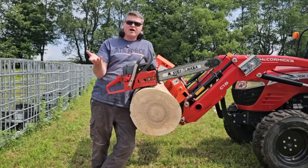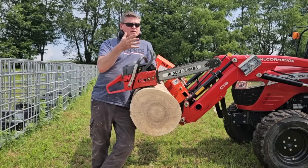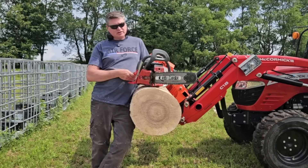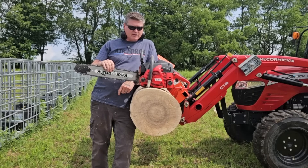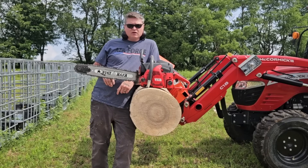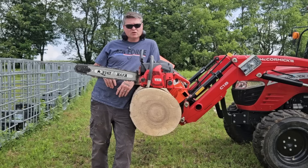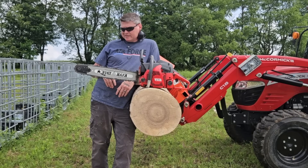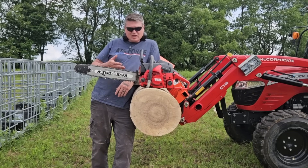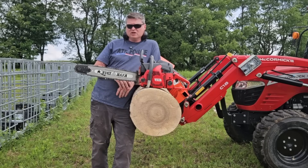Another thing I'm going to have to do is it's got a fine muffler mod, but I didn't want it to be super loud. I'm going to have to do a bigger muffler mod because we need stuff to get out better — we're going to try and get more RPM out of it. I think this is going to be fun. Both of those saws — the 562 is worlds better than this. It's super vibration-free and really capable of power. That thing's bone stock. And this one, while it's not traditionally ported, does run really good. A lot better than it was factory.